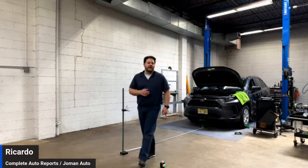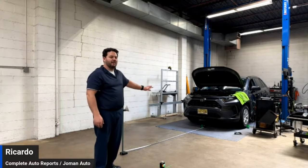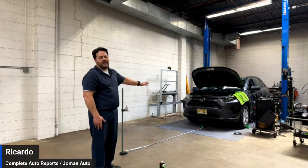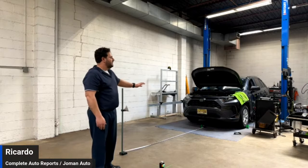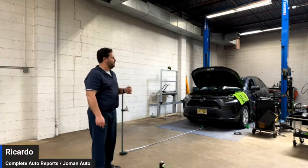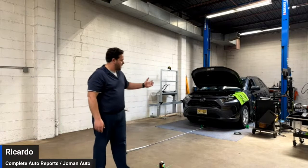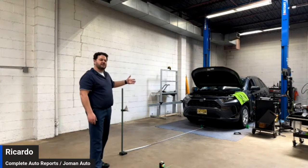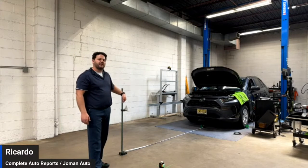Here in front of me I have a 2020 Toyota RAV4. We've already performed a radar alignment and radar calibration on this vehicle, and we're going to go over some of the steps that we did. Looking at Toyota's documentation, which is easily found, you will notice that they do not show a left or right side line — only a center line, with a measurement from the front bumper forward of about 3,000 millimeters.